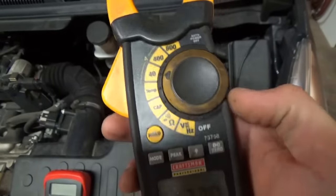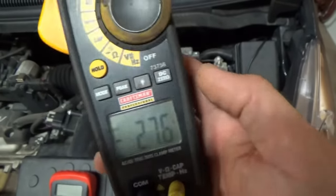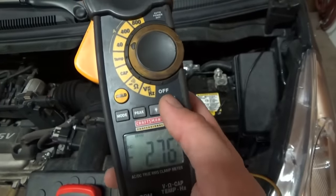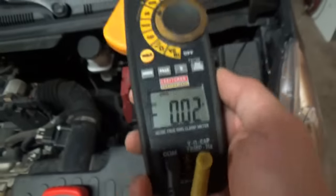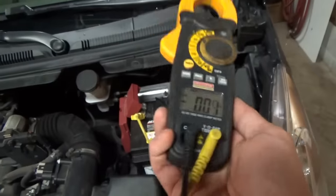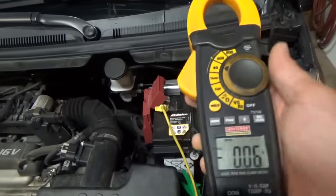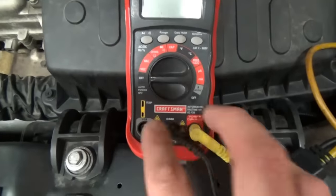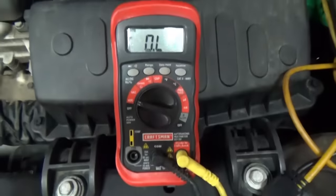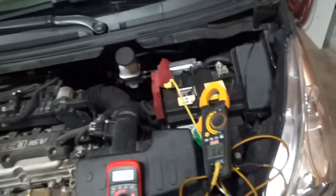Turn this on to the 40-amp setting. As you can see we're at 2.7 — we're not measuring anything, so we hit the zero button and it's zeroed out. You want to make sure it says DC and zero. We'll use this to measure current, and use our other trusty voltmeter for voltage — just turn that to volts, throw it on the battery: 12.6 volts. Healthy battery, right? Fantastic. We're going to leave the amp clamp in the amp setting and stick it on the negative battery cable.